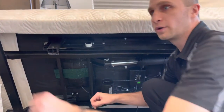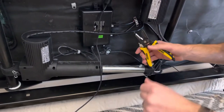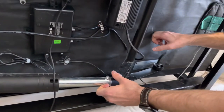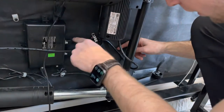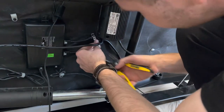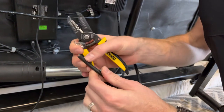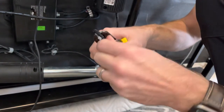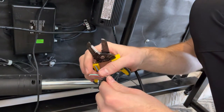We'll grab a pair of wire clippers — these were just five dollars from Amazon — and then under the bed, this is going to be our foot motor. You can see the piston extends to the foot, and the head motor is up here. If we follow that down, we'll start with our head motor — that wire wraps around and plugs right into the main control unit. I like to leave a couple of inches at the bottom, cut that off, and then pull the cord through. Inside you're going to have four, five, or sometimes six wires on advanced models. I like to just perforate about an inch or so down on the casing.